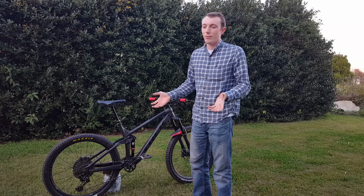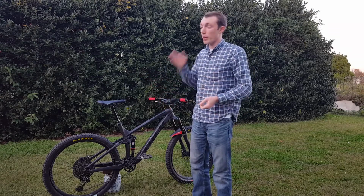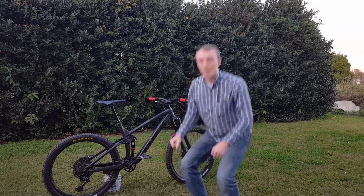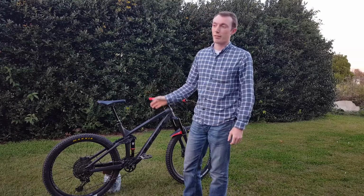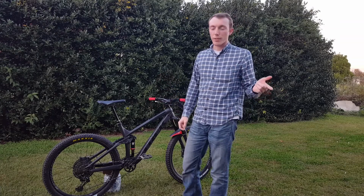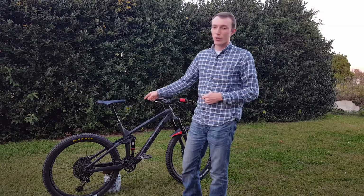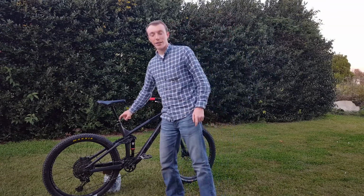So, I mean, what are you supposed to do? Eventually I learned, if I'm out there riding in the wet and I get a lot of stuff on it, sit down, slam down, right? That's the only way that it works in the wet. Definitely a low point. You know, the KS on my other bike works fine in the wet. So, Bontrager, if you're listening, it's all about this seal right here. That's what's causing it.